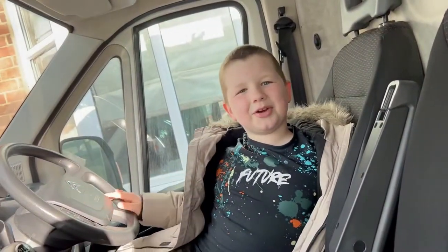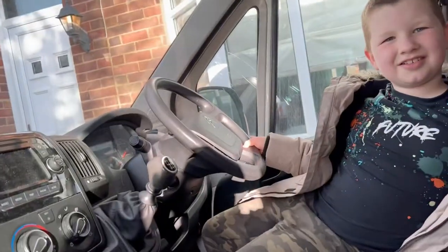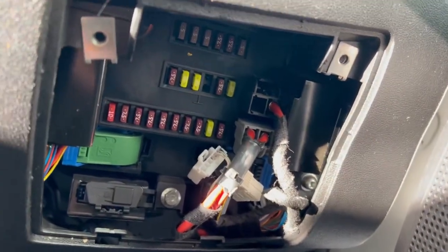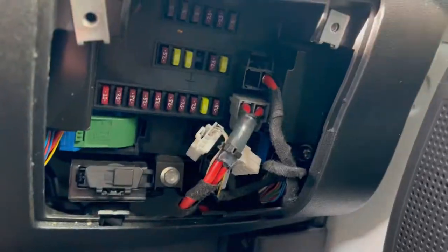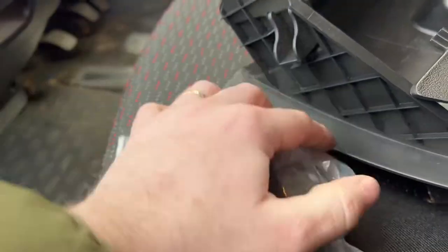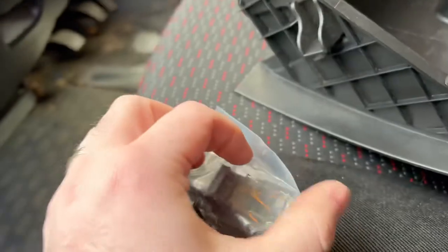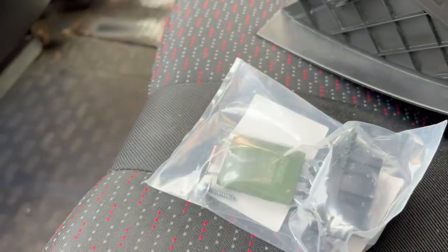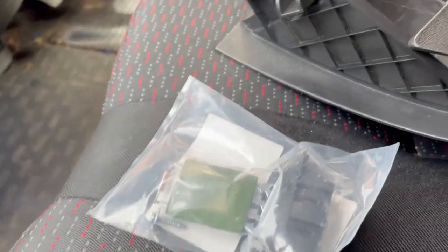What are we doing today? Changing the blower motor resistor. We know it's the resistor — we've had that panel off. Eli whipped that off. There's loads of stuff in there, but it's not what we wanted. It's hidden underneath the passenger seat — basically that little bit there. The old pin needs taken out — it has a wiring clip onto it, and this actually hides inside the ducting of the heating system so it can stay cool.